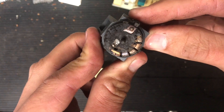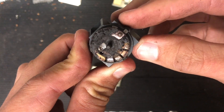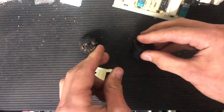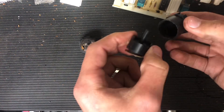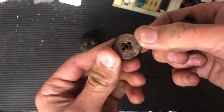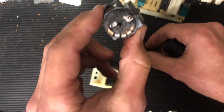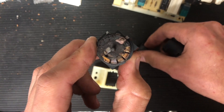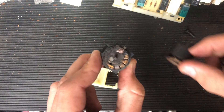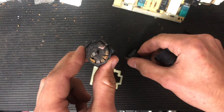These are completely burnt up. These are tiny switches — I don't know what I would use this switch for, but certainly not something with such a high current draw like a blower motor. This part is spring-loaded and that little nub there will contact the respective contacts and give you different blower motor speeds, with the highest one closing that relay and delivering full battery voltage to the motor.